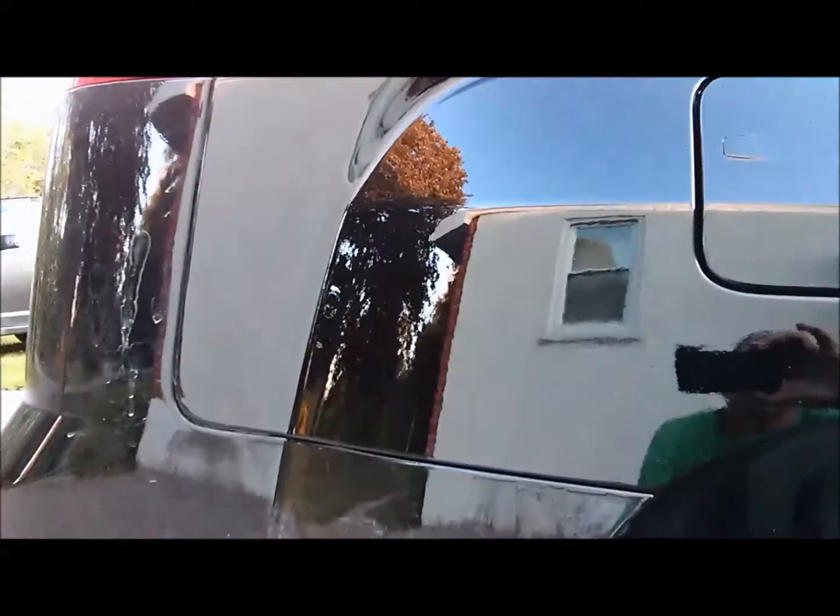Okay, this is only like the second or third time I've tried doing a clear blend like this. It flew up into that edge right there real nice. I just put a little reducer in a little touch-up gun, turned down really low, and blew it in along the edge to help burn the clear in.